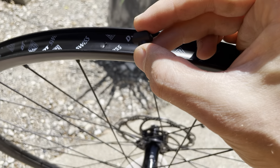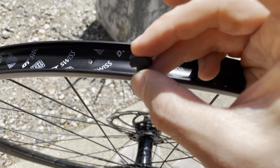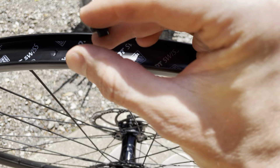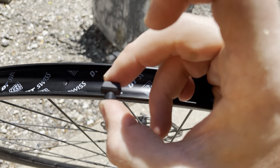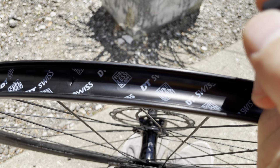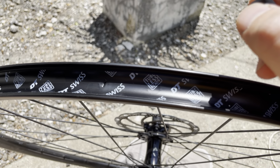These are the Axis Elite wheels that came on my Specialized Diverge, so just a little tip for you: if you're trying to get a good seal, this is what I had luck with. I also had to redo my rim tape — initially had 21 millimeter, took it to the shop and had them do 23 millimeter, and that seems to be working out better.